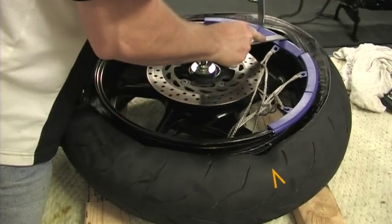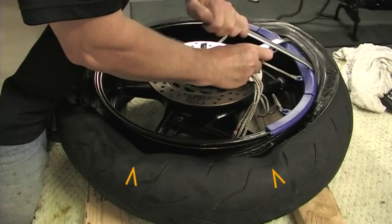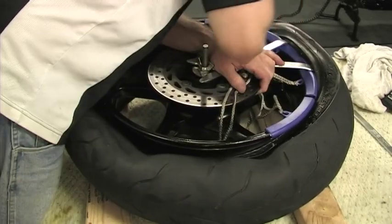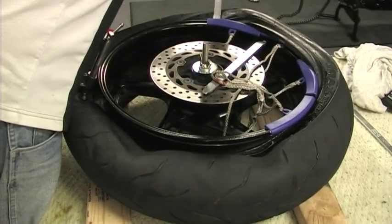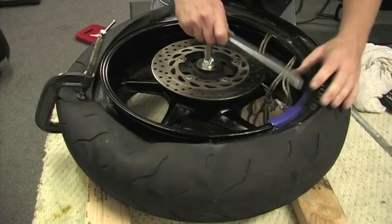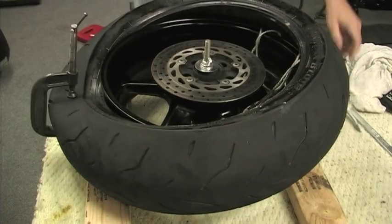Notice as I pulled the first iron over the number 2 protector that the tire is already beginning to roll under at the side. Again, this is what we are looking for and is an indication that we can proceed. A second iron on the number 3 protector pulls the bead over further, and then I just keep working it around and the 190/55 pops off as easy as that.